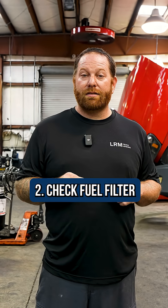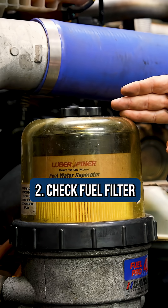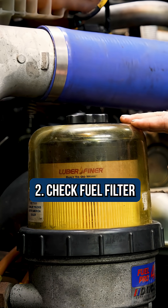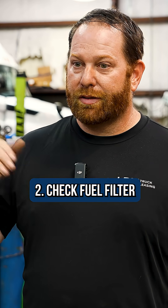The other thing is the fuel filter. Keep in mind if the fuel water separator fuel is all the way up on the top of the bowl, it may have picked up bad fuel. Don't forget to put some fuel additive in there and then replace the fuel filter. Or if it's up just because of time, replace the fuel water separator.